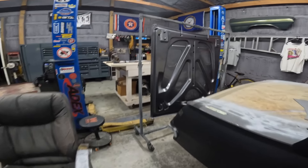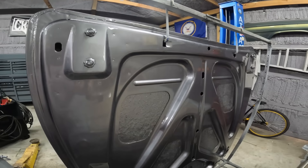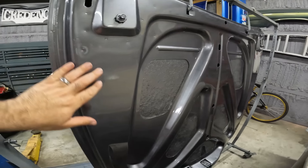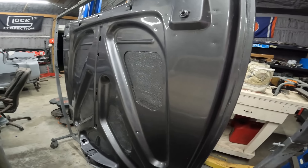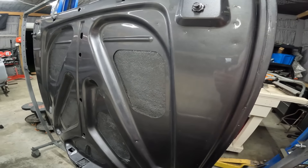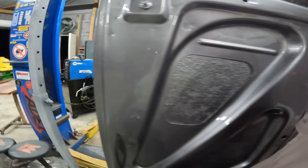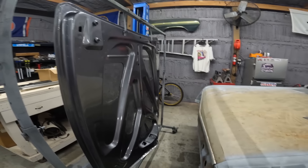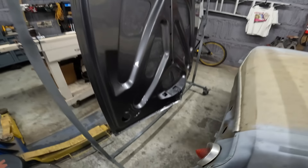I don't think we showed the color on the trunk — a big area. We did it outside in the backyard and it got no trash. That's amazing — and it seems like when you do that you get better results. I bare metaled it completely and then epoxy. Did you sand the epoxy? No — so you bare metaled it, put full strength epoxy, and then put the base coat over it in the same day, with unreduced sealer. I started in the morning and by right after lunch I was done — just hit it non-stop.